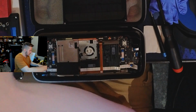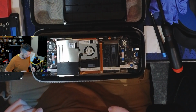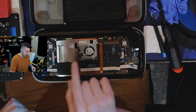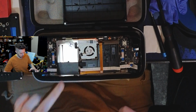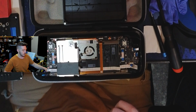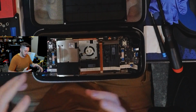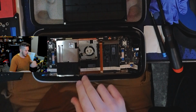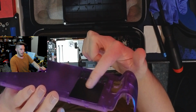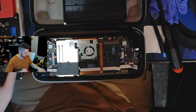But first, before I put this on, I've got a couple things I have to get done. First, I do have to pick the buttons I want, which I'm going to do next, I think. But I also have to take this whole thing off because we're going one step further. I'm going to replace the thermal paste with this thermal pad, this FROSTSHEET thermal pad. So that should cause more heat to go through to the cooler, to then go through to this backplate here, but then it's going to make this hotter. Theoretically. We'll see what happens.